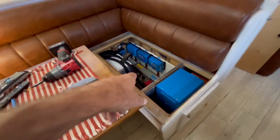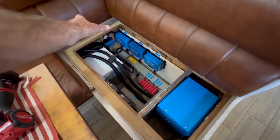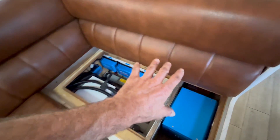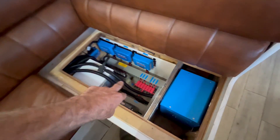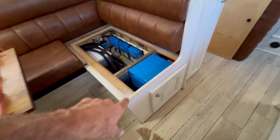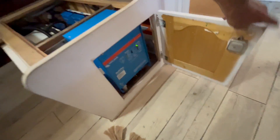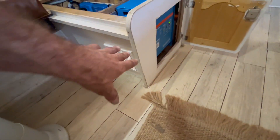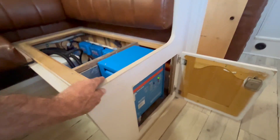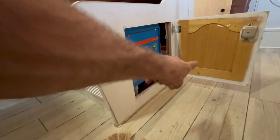I'll put up some photos of what it looked like before. We've done this whole Victron suite — as you can see there's a lot going on down here. This was an absolute mess; we've just tidied it up the best we can and basically redone all the existing 12-volt circuits. These two going through here are heading into the area where the inverter is. Previously the original inverter was in this position, so it's vented there and around the back. This whole cupboard's pretty much open but you can see how high it is — it's pretty much flush with the bottom of the seat, so you need good ventilation around it.